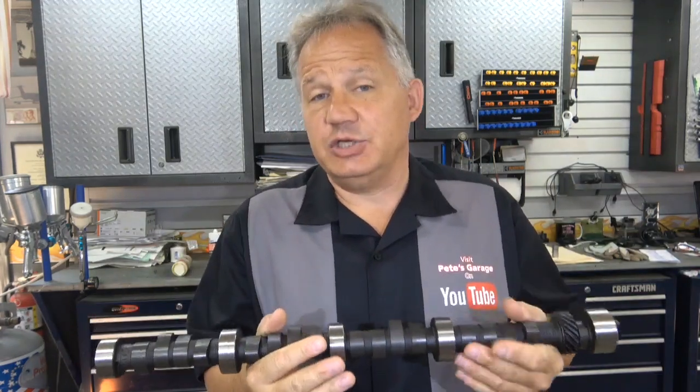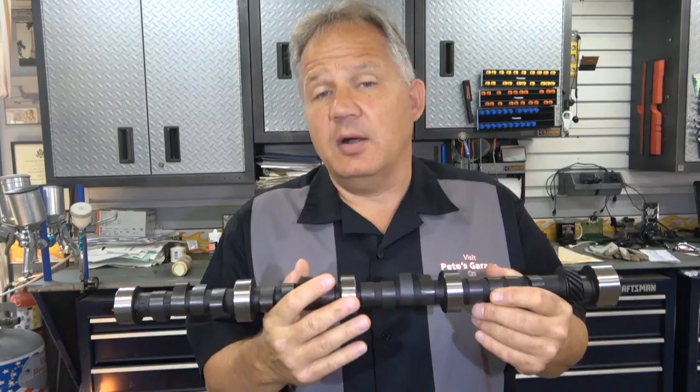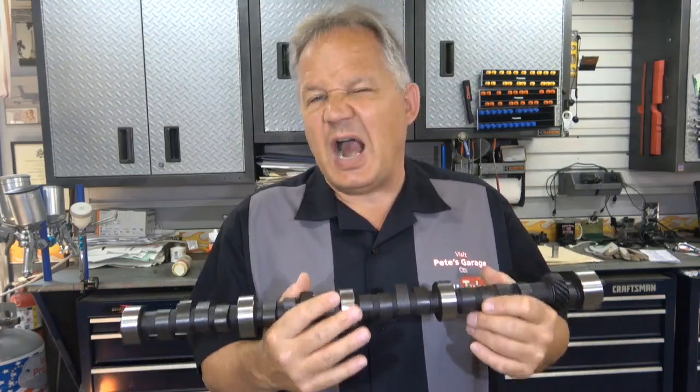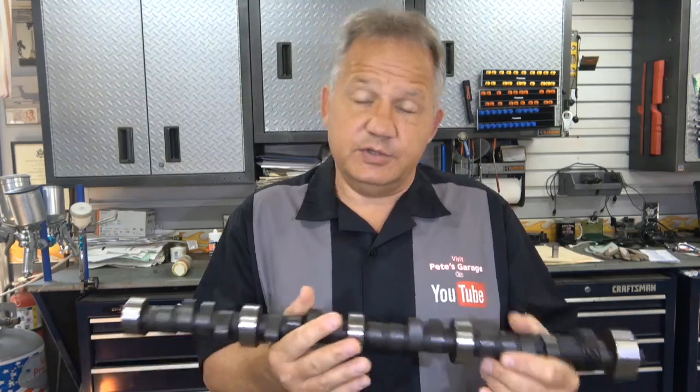That's one of the big considerations right there. Break-in will take at least 30 minutes, and if you're doing it on a dyno, that's an additional 30 minutes plus the gas — so there's additional cost for that. While this may be slightly cheaper than a roller, there are break-in considerations. Think about that when you're choosing your camshaft — are the benefits really there for this versus what you're choosing? But the owner chose this, so this is what we're installing.